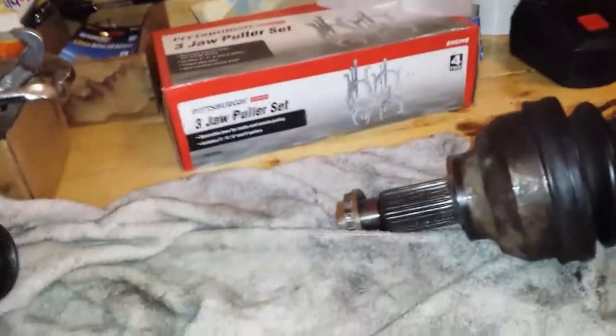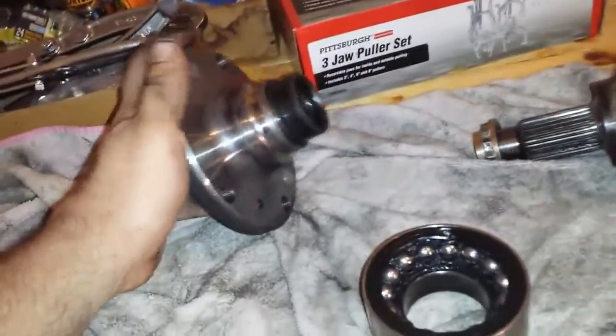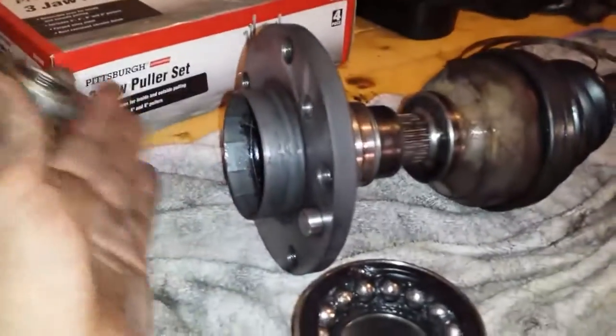The bearing sits on top of that, on top of the wheel hub, and it slides inside the wheel. And what holds all of that together is this nut here. Of course, besides the compression, this one goes through here. I don't want to put it in because I'm going to have to take it out anyway. But the nut goes over here and locks it inside. So these are the bearings, wheel hub, the axle nut, the axle, and this is the car without all of that.